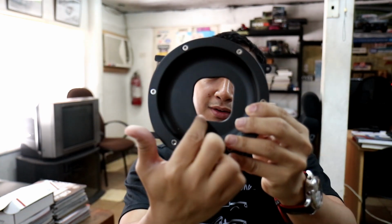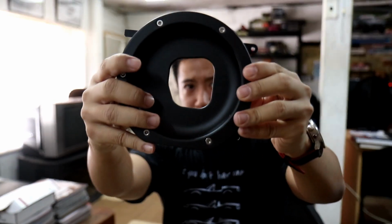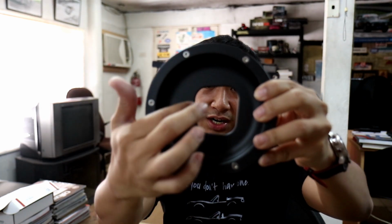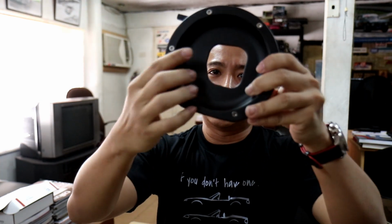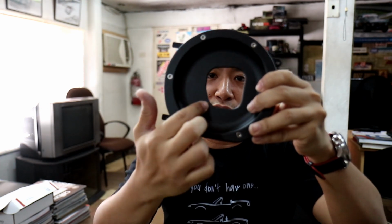Now this thing is made very well, but as you can see here, there's this area here. This one goes near the first gear and reverse, and it's an oddly angled shape. It's squarish, but it's not really square. It's like you should have just machined this through here. And apparently there were reports that some buyers with their NDs had some fitment issues here. Sometimes the gear won't engage completely.